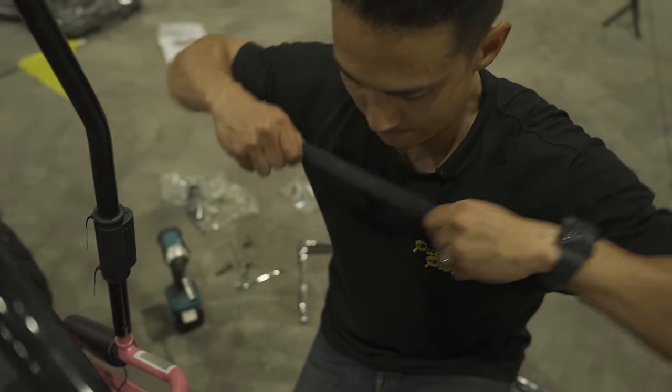Before you get up and go, make sure you tighten all the nuts and bolts on your roll cage, your frame, your axle nuts, and your spindle nuts. Always be sure to check your engine's oil — the dipstick is towards the front of the engine right behind the seat; it's a black dipstick. These engines do ship with oil, but it's recommended you start the engine, let it idle, ride around a little bit, then drain all that oil and replace it with fresh oil. Also make sure your chain only has about three-eighths of an inch of play in it. If it's too tight you'll wear out the teeth; if it's too loose the chain could pop off the sprockets.